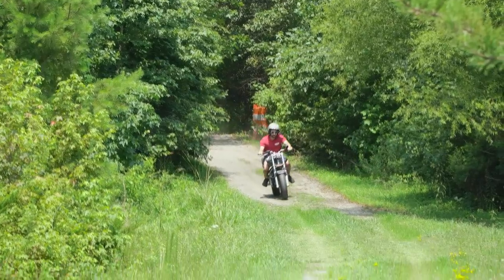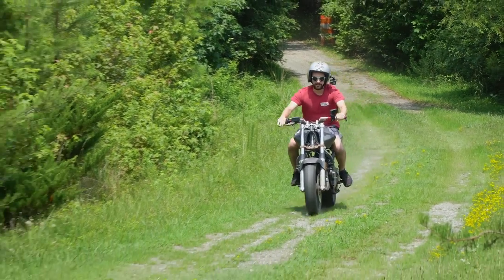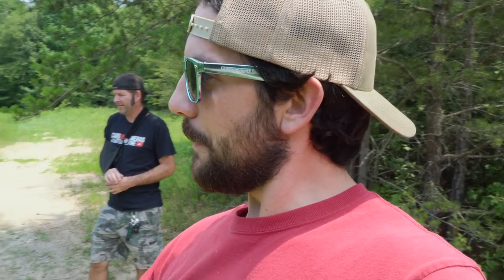In today's episode of Cars and Cameras, we tripled the horsepower output, went from 6.5 to about 18 horsepower with this Tillotson 225 engine. We have our work cut out for us because we're planning on road tripping this bike, making it street legal again, and taking it to a bike show. 38 miles an hour isn't bad, but we need a lot more. So we need some drastic gearing changes. We're about to go in the shop to see if we could even fit a second engine above our current one. That would be awesome.